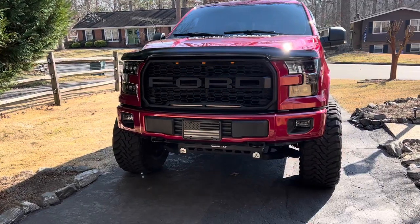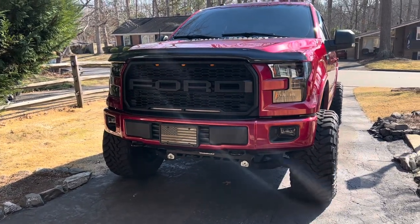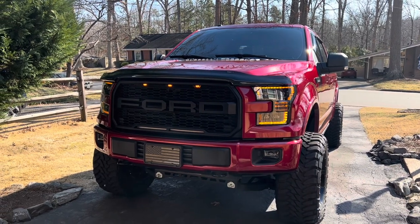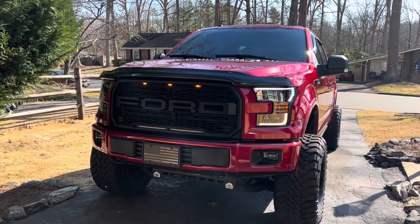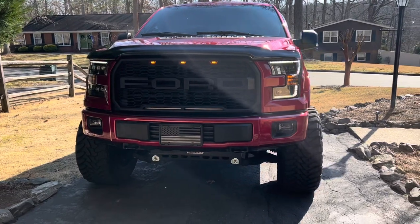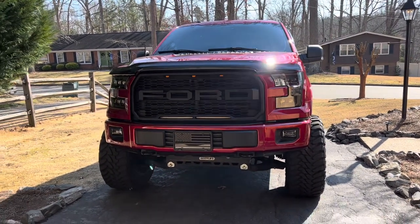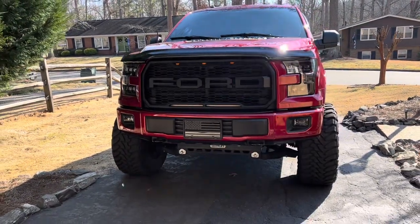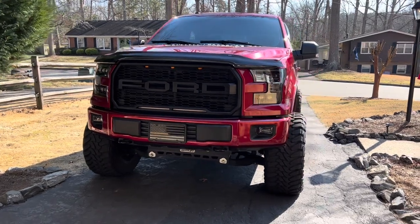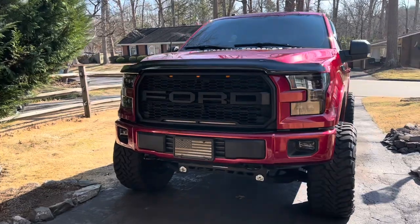It's all finished. There's a glare on the camera, but you can see the lights in the two openings — they're clear versus the dark surroundings. I did not wire it into my headlights. Treat them just like fog lamps. I've got a switch inside the cab that I will turn on, and it will come on with the switch. You can wire it into your parking lights — they give you the option. I just don't like going down the road with bright lights on the front of the truck the way some guys do with LED fog lamps — it really blinds everybody. I love that look for the cruise-ins and the shows. I'll show you a shot after dark.